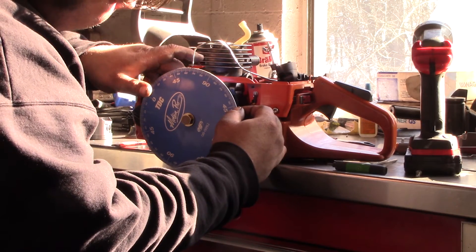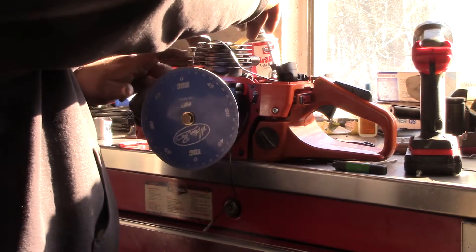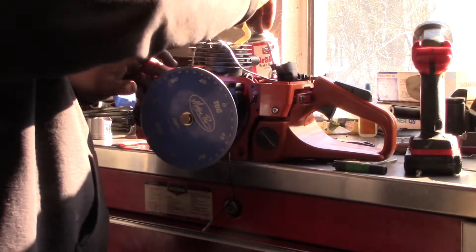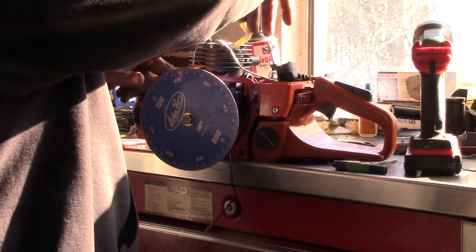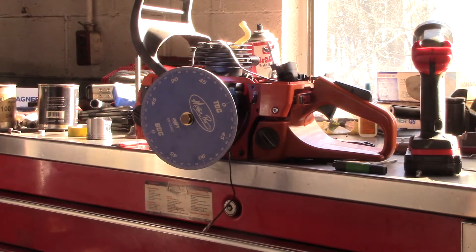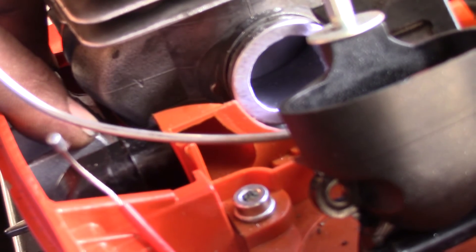Maybe it needs to touch just half a degree. If you have to move it 10, you go 5 — you just split it in half. Here's 65. Let's take a look at this intake timing. Here it is, about right there. We have on the wheel about 80 degrees.